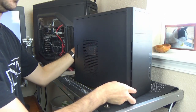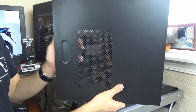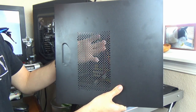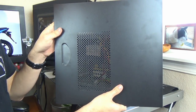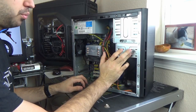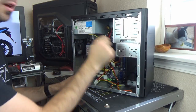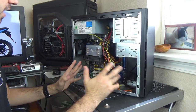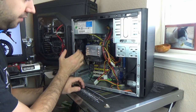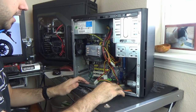I already went ahead and put a system inside. You can put two 120mm fans on this — there isn't really a dedicated spot for it but you can definitely do it. On the inside you have two hard drive bay areas, and I believe you can actually put three 3.5 drives in here if you use the exterior 3.5 drive bay. The case basically came with just a rear 92mm fan, which is nice. No front fan, so I threw one in.